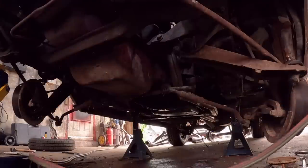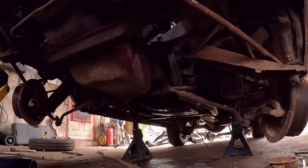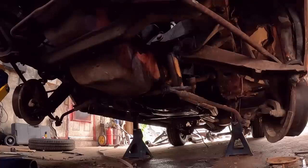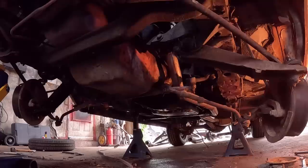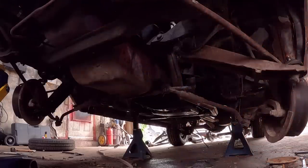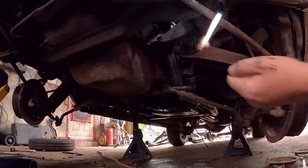We're gonna try and heat up this nut. Unfortunately, what I'm sure is probably gonna happen, the bolt that goes through sometimes can get stuck on the bushing and stuff like that. So it may be ugly coming out, but a little bit of heat will fix everything, right? The other side was obviously completely butchered up, which actually was bad for driving, but yeah, nice to remove it. The hammer.